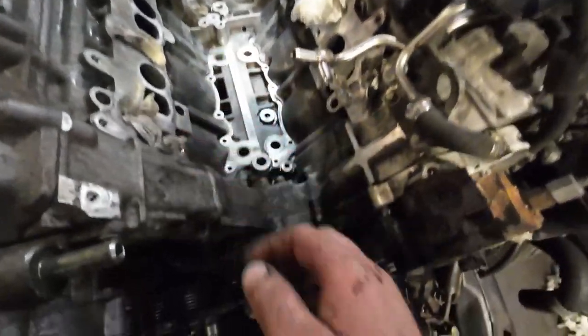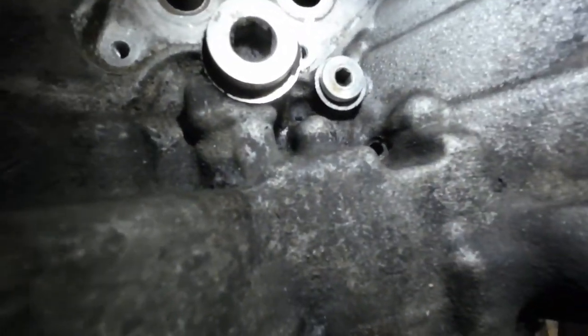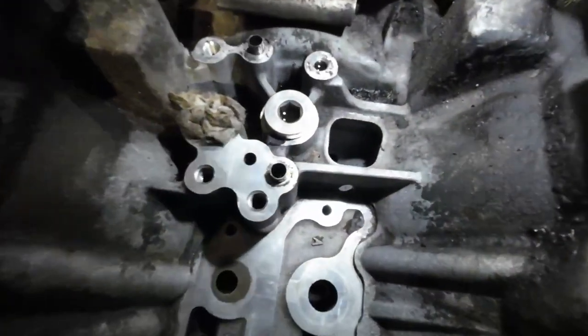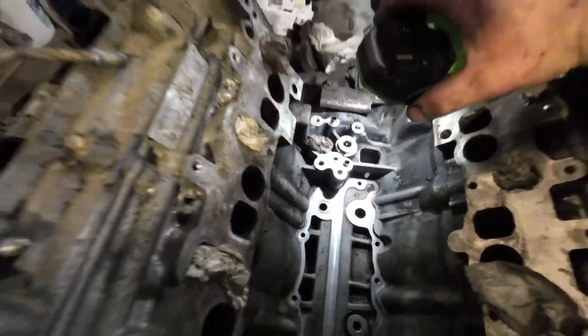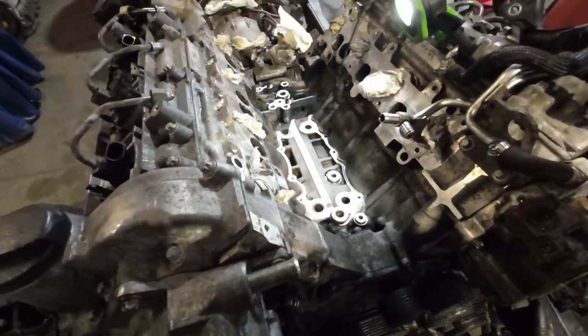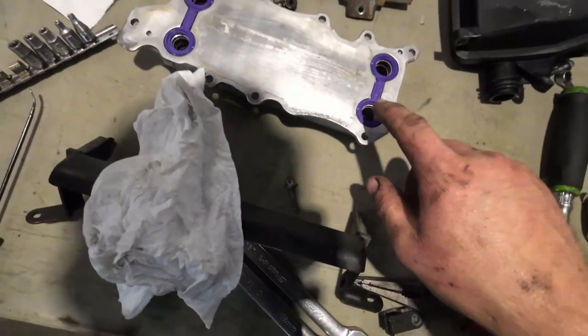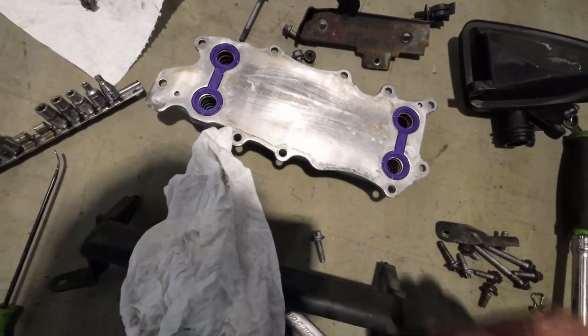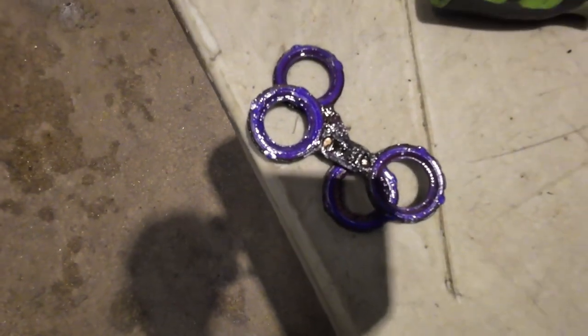We have this all cleaned up. While I was in here there are two drain holes - there's one right there and one down in there. I went ahead and got those all unclogged. All I did was run a metal rod through them and then blew them out with compressed air. Now they both drain so it should help prevent anything getting built up in here again for a while. Got the new gaskets installed on the oil cooler - now I'm going to go ahead and pop this back in. Here are the old ones - they were a little cruddy.